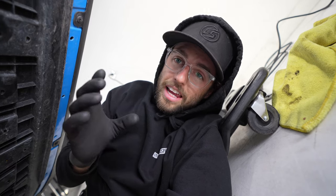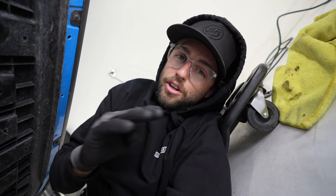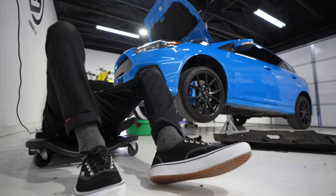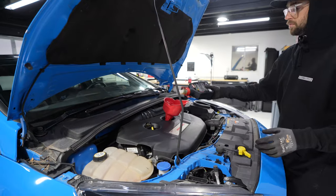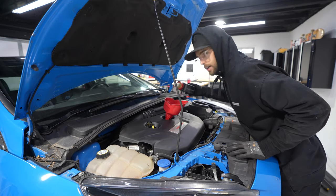Just check with yourself real quick. Drain bolt snug. Check. Oil filter hand bicep tight. Check. There's only one O-ring between the filter and the block. Check, you're golden. That good, good. That money.